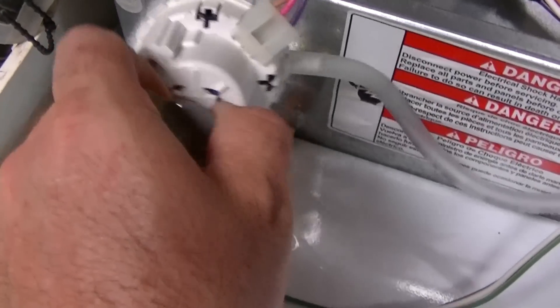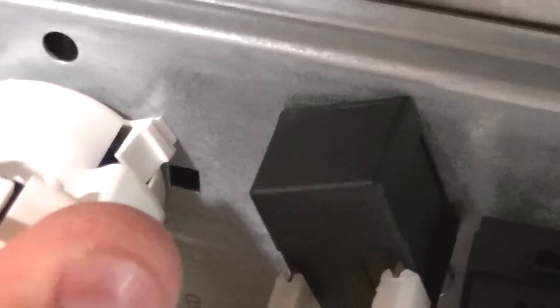To mount your switch back up, pull the knob off, get that part right in the hole, and rotate it until it locks. Close it up — those little tabs will go down into the grooves. When you put the two screws in the back, it won't allow it to slide forward and unlock. Then put your knob back on.